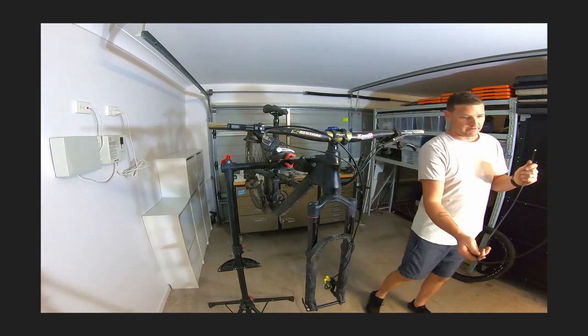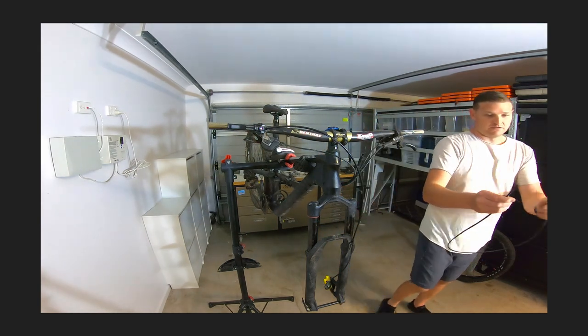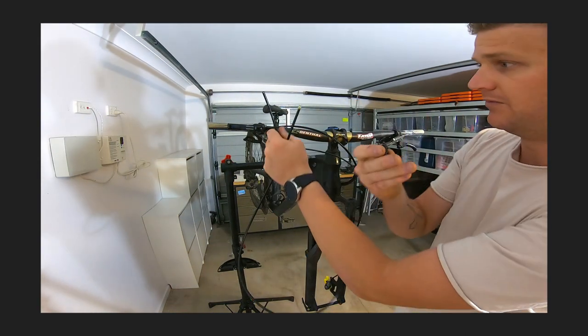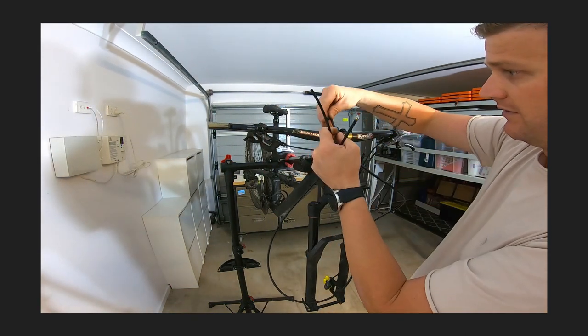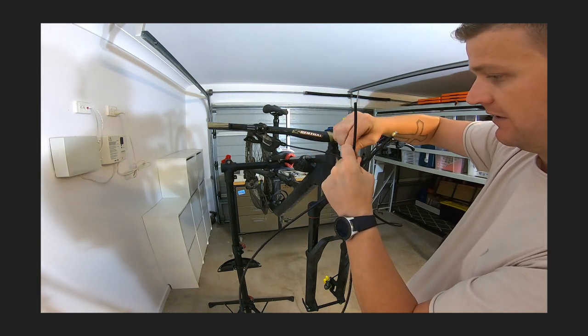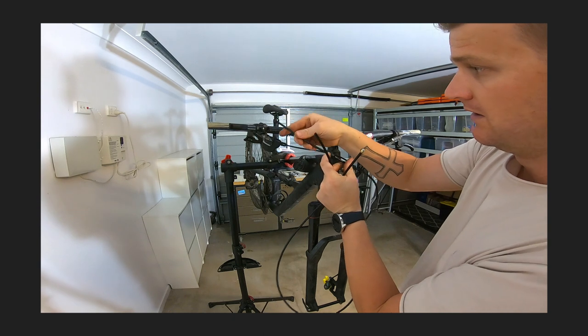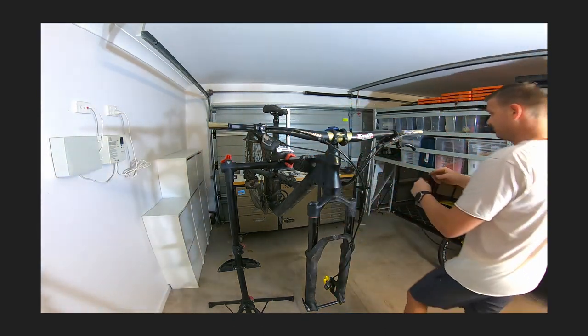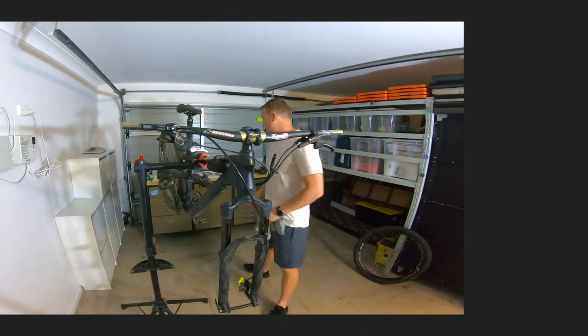Now after you do cut your brake line, first things first, pop these fellas back on, because otherwise you get to putting ferrules on and all this sort of stuff, and then you gotta pull them all back off. That's not cool. Good news, got some bits.